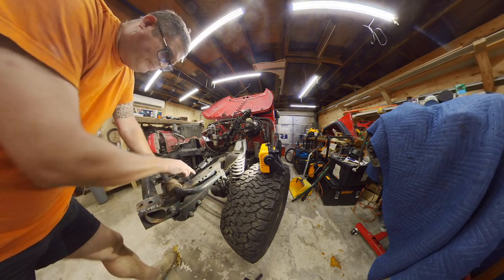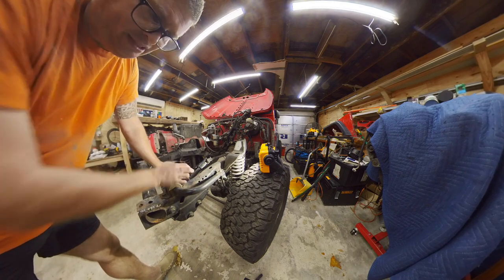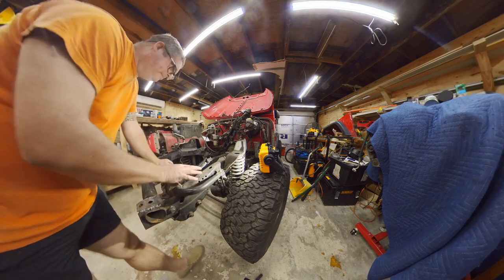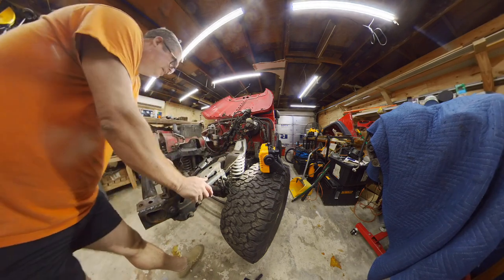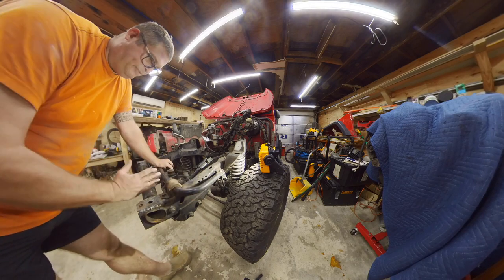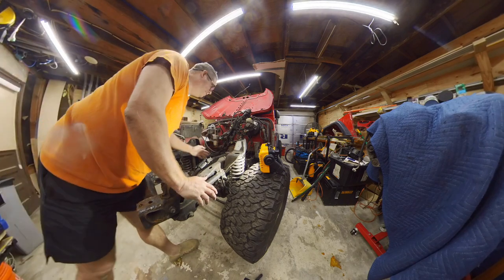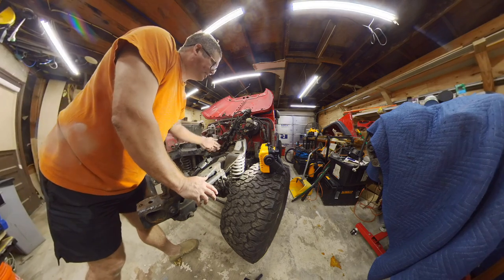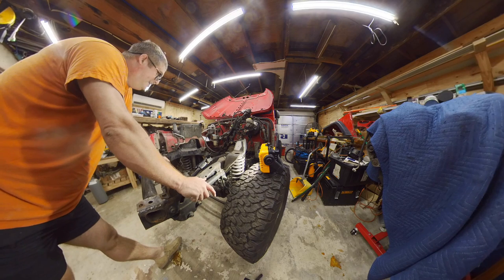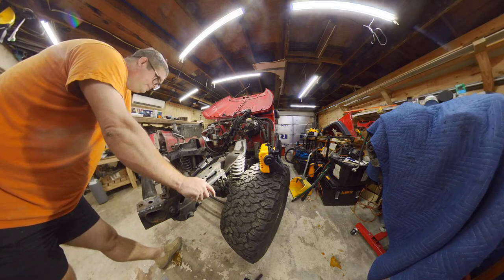You know, this is a crumple zone, so the fact that this isn't really deformed tells me that I have some issues here with the frame. I mean, clearly from here to here is not in the best of shape. In an ideal world, maybe I would section it from here back to here, but this is a really complicated piece of geometry, so I'd probably go all the way back to the tub if I was going to section it. And I'd rather not do that.